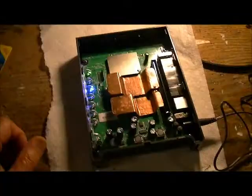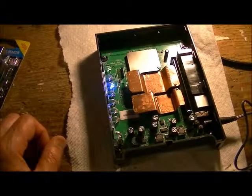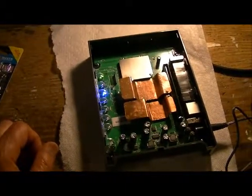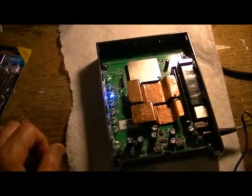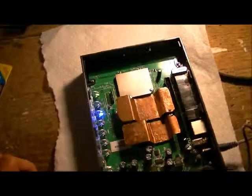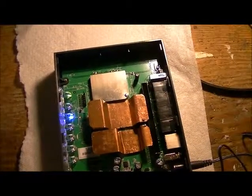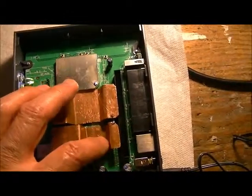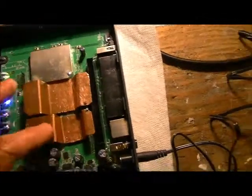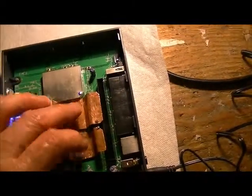It's probably best to do it after you start to notice a little bit of a problem, not right at the very beginning. To improve longevity and better cooling, I've modified my router — this is the Netgear WNR 3500L, first revision. I took some three-quarter inch L copper pipe, cut it, flattened it, and formed it into this shape — this one is the chipset CPU and this one is the gigabit switch chip. This should improve the cooling quite a bit; right now it feels slightly warm rather than hot.